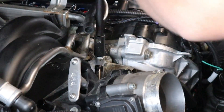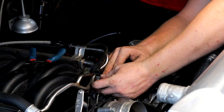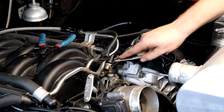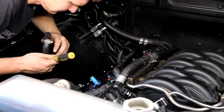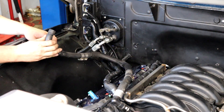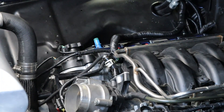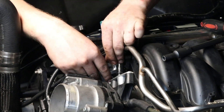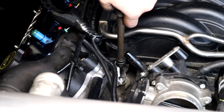Simply fasten it, put some Teflon tape in there, and it should be good to go. Since the customer does have a set of gauges with a water temp sender, we're just going to remove it from the hose being omitted and apply it here to this water neck. With the water temp sender installed in the upper water neck, we're going to make the contact to the gauges with the wire and tighten it down so it reads properly. Next, Mike is going to remove the heater hoses already installed on the truck. They used the factory hoses at the heater tubes with the factory connections, which includes the restrictor in the passenger side version. We're not going to need that restrictor because it's built into the aluminum tubes we're going to use to replace the factory ones. Mike is removing the passenger side heater tube, prying it out of place and replacing it with the new aluminum one from PBH. Once it's set in place, grab your tools and tighten down the fastener supplied in the kit and it'll be ready for use.